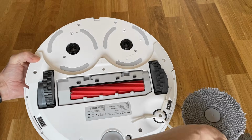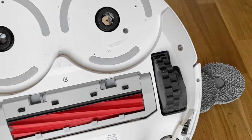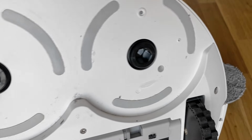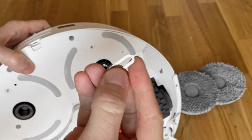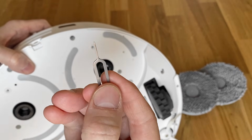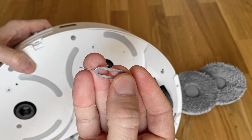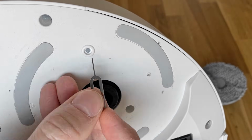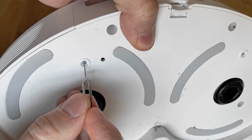This was caused by some little dust particle or other type of dirt that for whatever reason had gotten stuck inside the water jet nozzle underneath one of the mopping pads. No idea if this is a proper or even a good or safe way to solve it or not, but I got my machine working again by simply using one of those tiny SIM card tray ejector needles that you get with every new cell phone, and then pushing it into the hole one time and spinning it around a little. And after that, both mop pads got happily wet again and the floors got happily clean.